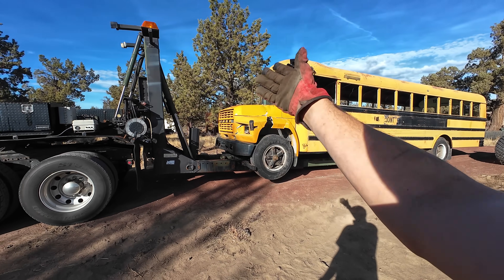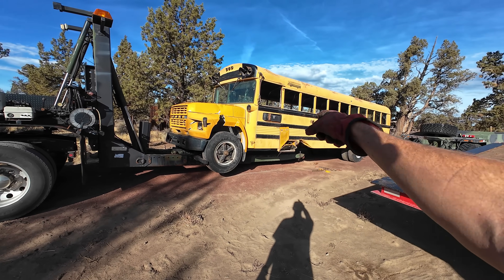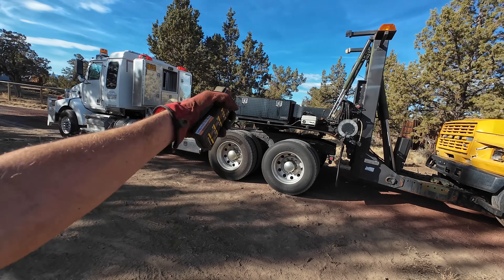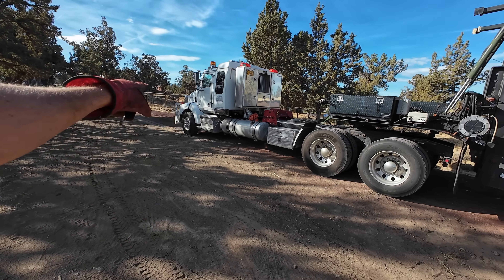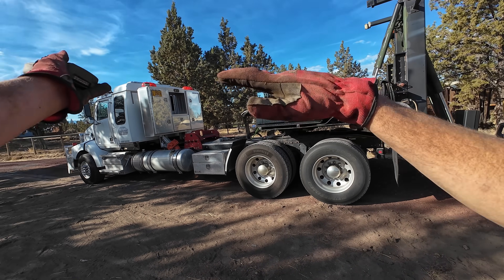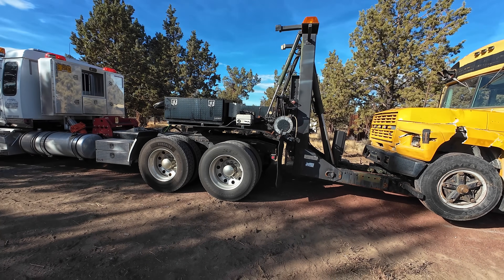All that heavy front end weight - loaded garbage trucks, loaded cement mixers, utility trucks, multi-axle dump trucks with 20,000 pounds on the front axle and 12,000 to 14,000 pounds on lift axles that are now up in the air - all of that weight is going straight onto your fifth wheel. You can adjust your fifth wheel just like pulling a trailer and change your weight distribution. None of the weight is prying back on the truck like a wrecker does. So when it comes to super heavy towing, this thing wins. Hands down, no two ways about it. But it loses in literally every other category.